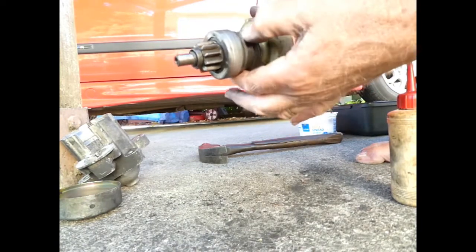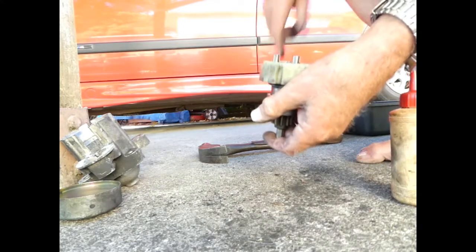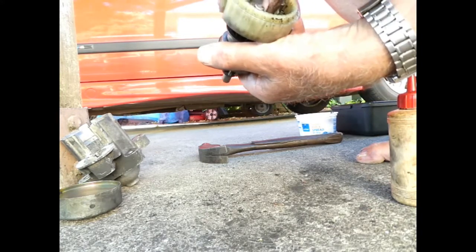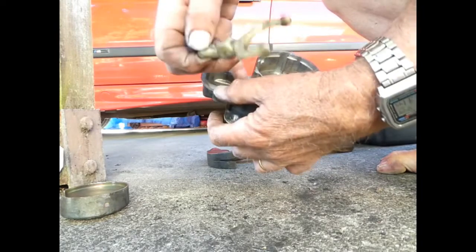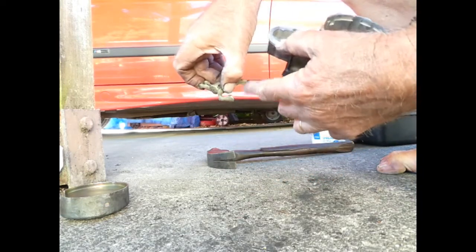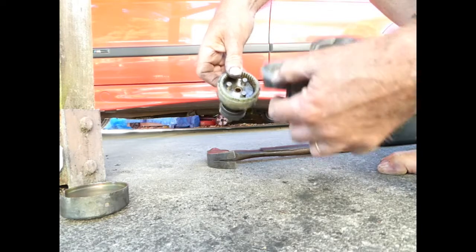The question of whether this should be greased — not too much, since that could get on the flywheel, but there appears to be some grease in there. Also the three little planet wheels definitely need grease, and definitely need some grease in that bearing bay. We also need some grease in here for this lever to pivot on, and obviously at the ends of this lever also. Just a general purpose grease will do — doesn't need to be extreme pressure, since there are plastic gears.